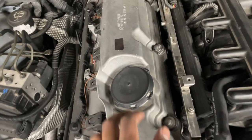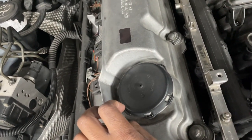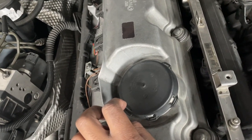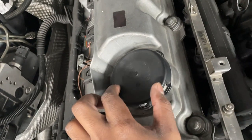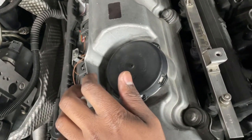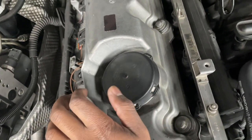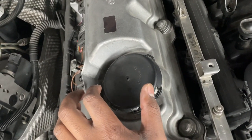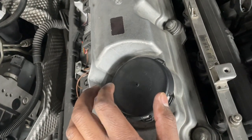Another question about these covers: can you replace the diaphragm inside the CCV on the cover itself? For the longest time the answer was not realistically — people on eBay sold aftermarket diaphragms, but the problem is taking this cover off basically guarantees you'll break it. There's no easy way to remove it; even using heat you'll crack the tabs. There wasn't really an economical solution unless you bought a custom aluminum one, which some people did sell and makes it serviceable.